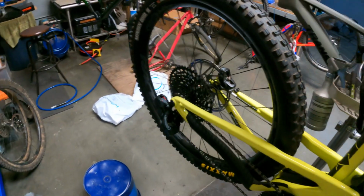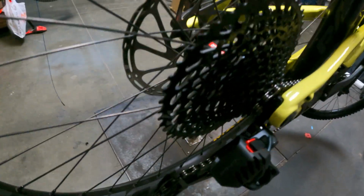The next thing you are gonna want to do is adjust your high limit screw. So you got 2 screws right down here on the bottom underneath the battery. They are not labeled. If you look on the bottom here, you can see where the screws touch the actual stop shoe here. So they're pretty backed out off of brand new.